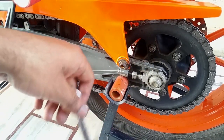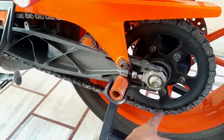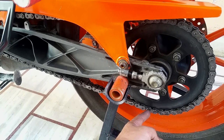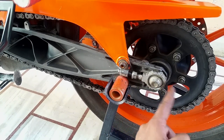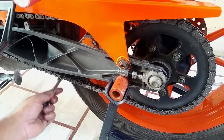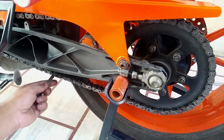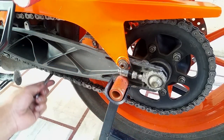Now don't worry about this little thing over here, I've added two more links in the chain. This chain is 114 links. Originally, the KTM RC390 has a 112 link chain and the RC200 has a 110 link chain. This one is 114, so I'll have to spin this, otherwise this side is always facing forward. So don't worry about it, it's pretty much the same. Now you can see, I have to tighten it up a little bit more and you can see right there